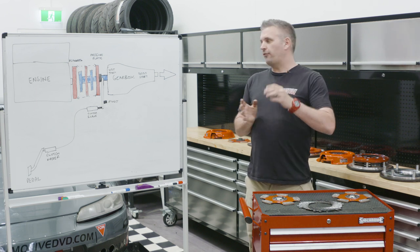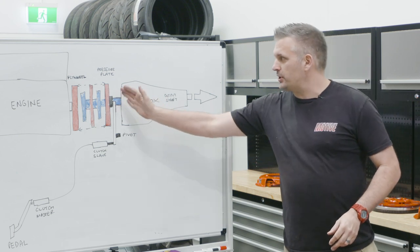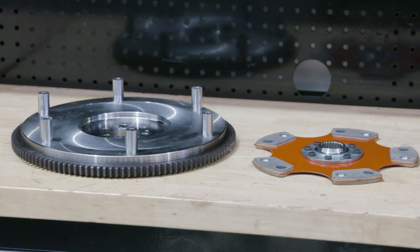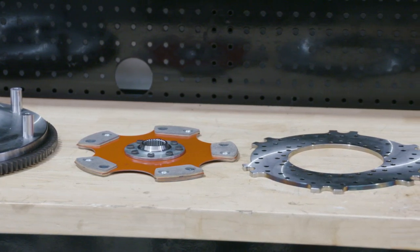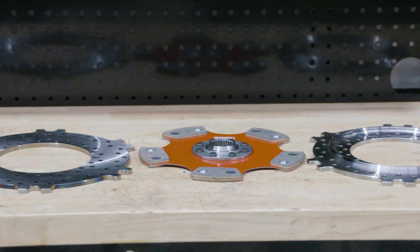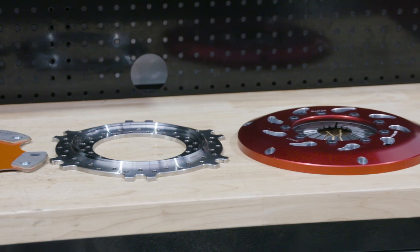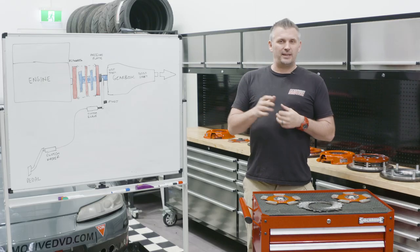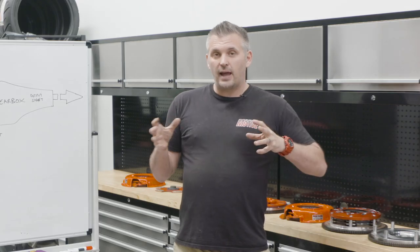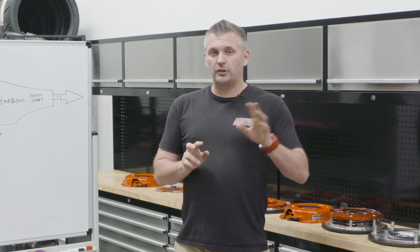What are the advantages of having a multi-plate clutch? We talked before about increasing the clamping force to increase the amount of torque it can hold, but the problem is the more pressure you put into the pressure plate, the harder it is to push the clutch pedal — so you reach a point where it isn't very drivable. Now what if you had the same amount of pressure but two clutch plates? In theory, two clutch plates could hold twice as much torque, and they could also hold twice as much heat. Same amount of pressure, but you can hold double the torque and double the heat, which means it can handle more power. You go to three plates, in theory it could handle triple the amount. In real life it may not be exactly double due to efficiencies, but it is all just a balancing act between how much heat it can handle, how much torque, how much it all weighs, and how much clamping force it has to determine drivability.